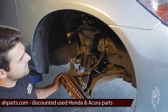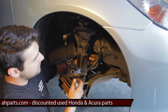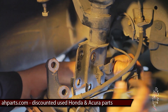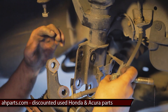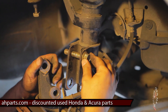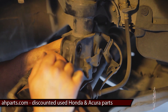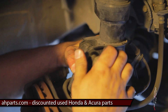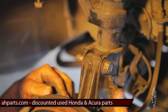Your next step is reassembling this. Once you've got those three nuts at the top holding it up, make sure your brake line and ABS line are on the right side — towards the front of the car. I've seen a lot of people put them on the back side and then they can't mount them up and have to redo things. Now grab the bolts you pulled out from the lower mount. Push the hub assembly back into the strut assembly, line the hole up, and send the bolt all the way through. Give it a wiggle and you're ready to be completely reassembled.